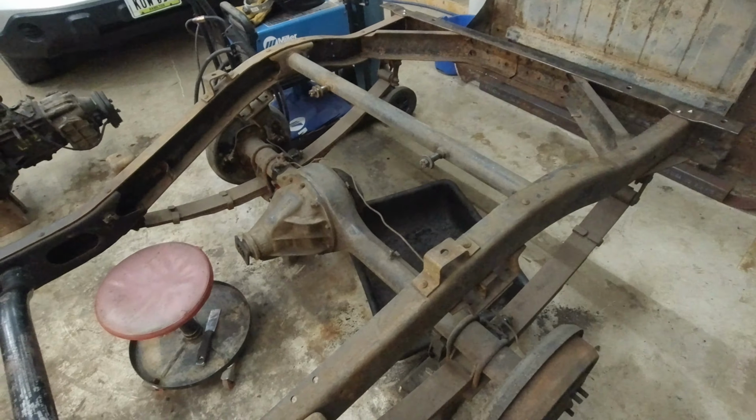I kind of quit the other day because all of my wire wheels here were pretty much used up. And these weren't meant for the speed of my grinder. So I went and got a bunch of different styles, and they are rated, because the old one was rated for 12,500 RPM. The new ones are rated for 14,000 RPM. So hopefully they'll last a little better. And I got one that's a little bit smaller, and then some of these. I didn't get any of the really lightweight ones because who needs that?